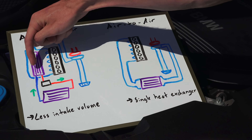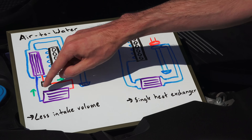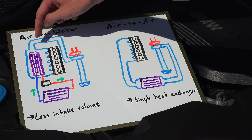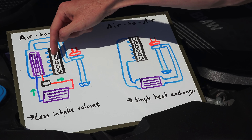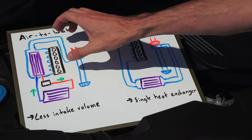It'll pass to the front of the car, be cooled, and then routed back into this intercooler. The air that is passing over that intercooler will be cooled by that liquid passing through. They're in separate chambers so you don't have any mixing, but that air then flows into your engine and works out the exhaust just like any engine once it's gone inside.